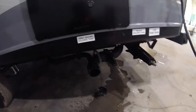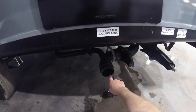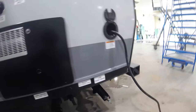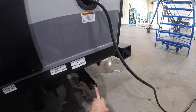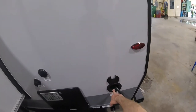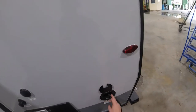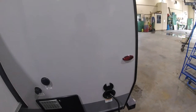Down below you'll see your black water and grey water valves and the outlet for both of those, as well as the cap. Right beside there we have one of the two stabilizing jacks. It's important that you level the trailer first and then engage these jacks for stability — they're not meant to actually level the trailer itself. Here we have the 30 amp power connection for your trailer. It comes with a large length of cord, so you should have no problems reaching the outlet when you need power.